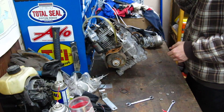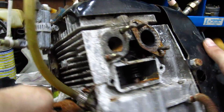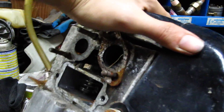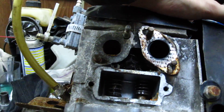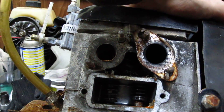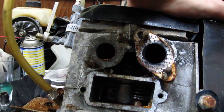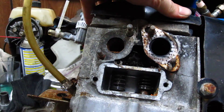See if we can throw a screwdriver in there. This is an easy way to see if your valves are stuck. What I have here is the access panel taken off for the valve springs. And when you turn the engine over just by pulling it here, you can see how the cam moves one valve up, then it goes back down. Then it should move the other valve up — but that valve is stuck open. That's a really quick and easy way to see if your valves are stuck rather than taking your top end off and probably having to replace the head gasket.